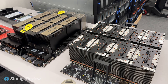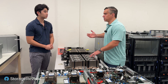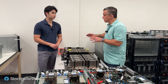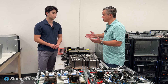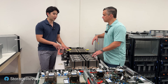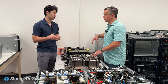It is very much a modular design. We talked about 15 fans in this air-cooled system, but over in building eight the Neptune team is working on liquid cooling. We previously looked at the 670 V2 which had a hybrid system with a radiator and closed liquid loop. With Intel GPUs coming in — it'll be a different server number but the same fundamental design — it'll have multiple liquid-to-air cooling modules and radiators within the system, because of the more extreme cooling needs with different GPUs and CPUs.